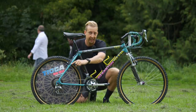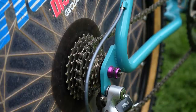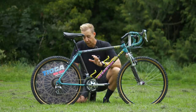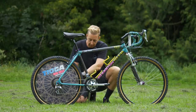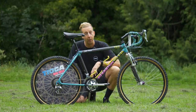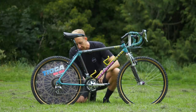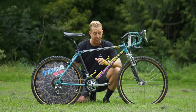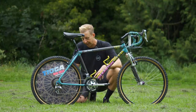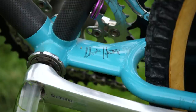The back end of the bike has some telltale signs that Yeti always used. Note the curve between the chainstay and the seatstay — that's just such a beautiful shape, so characteristic of all Yeti ARC and FRO frames of the early 90s. There's a really nice wishbone design using that lovely curved loop tubing joining onto a wishbone behind the bottom bracket shell. Pretty good chain clearance down here — nothing where you're going to get any chain suck, which was something you used to get with triple chain rings. Not bad mud clearance either, considering it was a bike that came from Colorado.